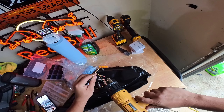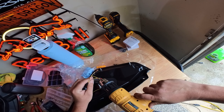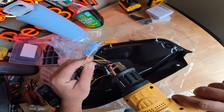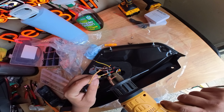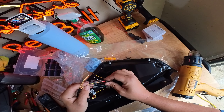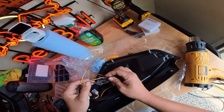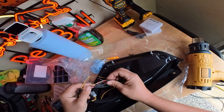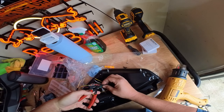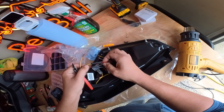Use this guide to splice in the wires. As you see, I'm putting in a solder joint onto the wiring — you can see it kind of shrinks and once it gets hot enough it's going to release a little bit of solder on that section. The solder just went ahead and popped, and then I'm using black shrink wrap to put it over it. Be careful when you're doing this — I'm going to have to cut a little slit in this one because it caught a little bit of the heat. Seal up your wiring really good; you don't want that stuff exposed when you put everything back into the car. There you go — it's over that joint and she's sealed up.